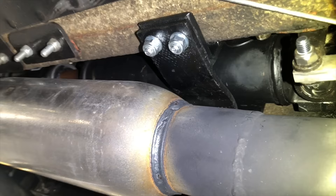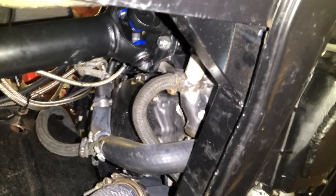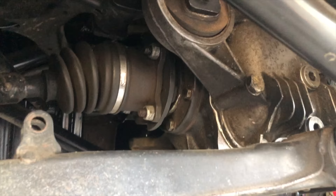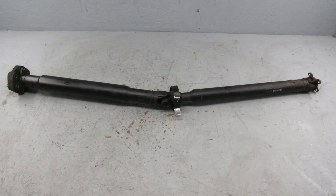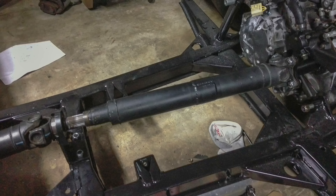I grease them frequently, I check them often, and I have drive shaft loops — which you should definitely have, because if you're making this stuff in your garage, who knows what's going to happen. If you do have to run some angle with your drive shaft, try to make sure that your rear angle is the same as your front and that your U-joints are phased correctly, and you'll get rid of any vibration there. Chances are your drive shaft is not going to be the correct length anymore, so measure the correct length, take it to a local drive shaft shop, have them re-weld it and balance it, and you're good to go. It's a little pricey, but you need the equipment to balance the drive shaft anyway, so you might as well have somebody else do it. The differential I'm using is from a BMW. I got it because it had limited slip, it had the gear ratio I wanted, and it was super cheap at the time. It's not really the best solution for this car — it weighs 80 pounds and can handle way more power than I'm ever going to put through it — but the price was right. Since I have that diff, I'm just using the drive shaft that came out of the same car. It's a two-piece drive shaft, which is kind of nice because my tunnel is a little too narrow and the output shaft of the motorcycle is shifted a little bit to the right, so I kind of need it to bend in the middle to make it all the way to the back.